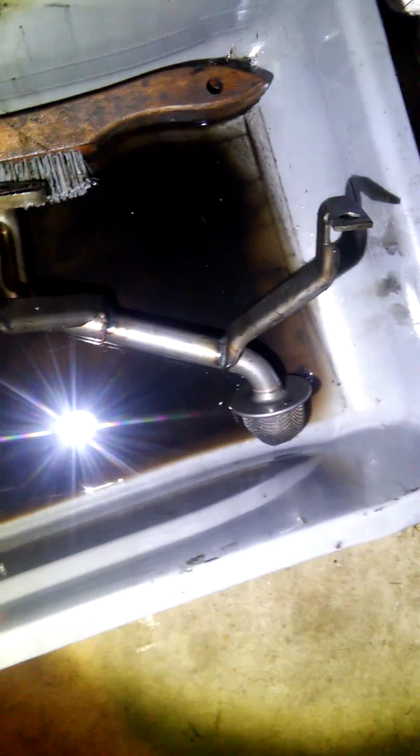This is that filler tube, or the oil tube, and those flanges right there, they're the support brackets. So with those 4 12 millimeter bolts that you're gonna let fall into the pan, boom. I do recommend replacing the filler tube pickup gasket right there. Clean that out. Clean out your pan. You're good to go.